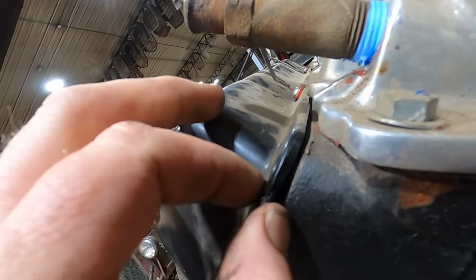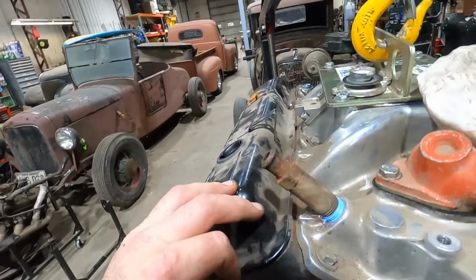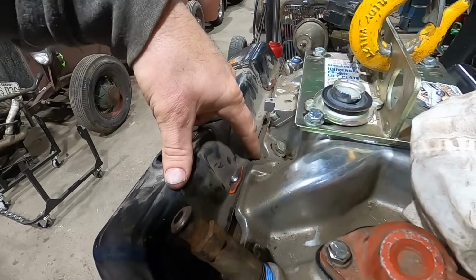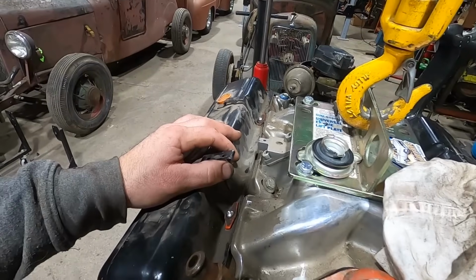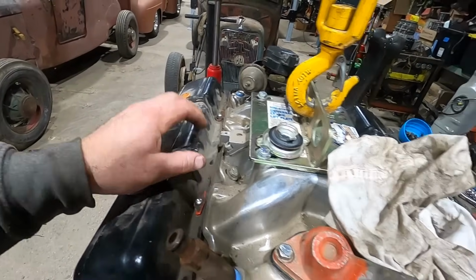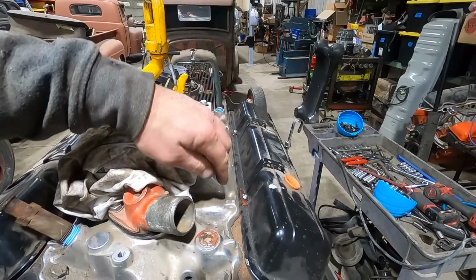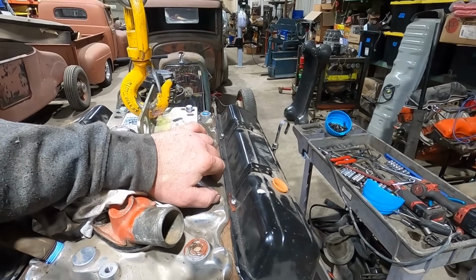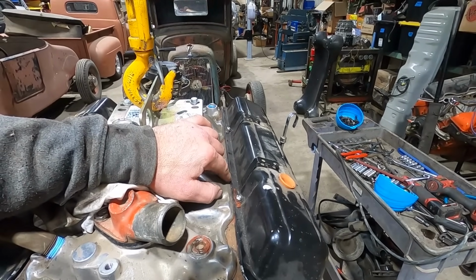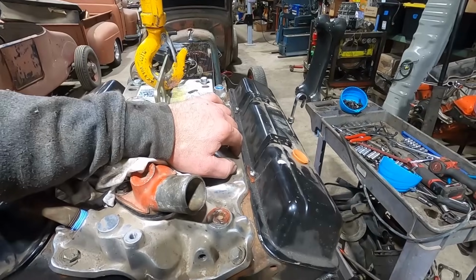And I noticed the valve cover gasket is just flopping around in there. So the valve covers are hitting the intake because I think the intake is cast too large. This side's better, but not by much. The front's okay, the back not so much. So I think we're gonna bend a tang on these nice steel valve covers, because I'm sure aluminum ones would do the same thing. And we're not gonna grind up a nice set of aluminum ones.